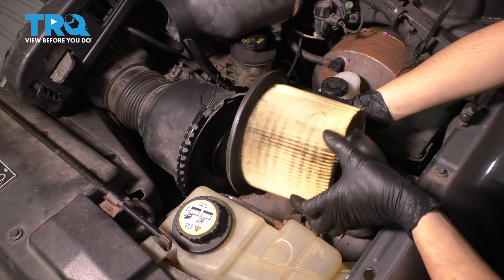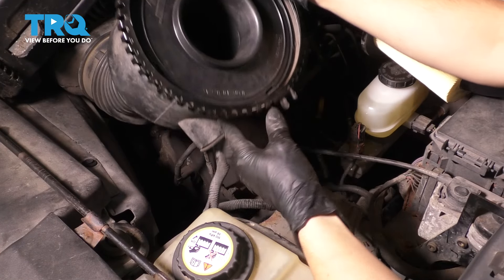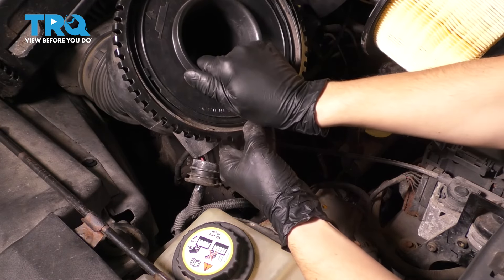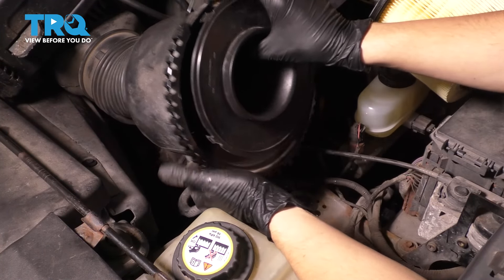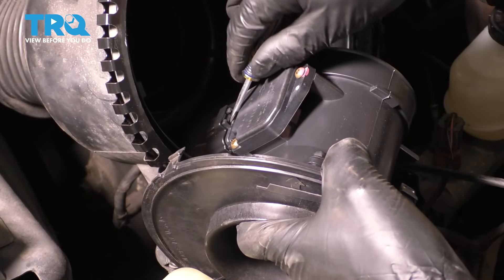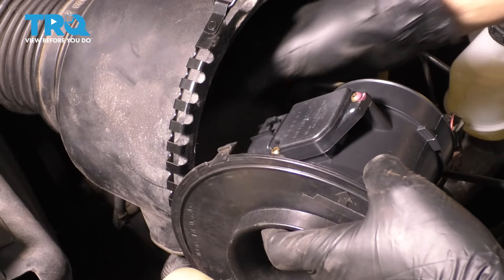As you can see, this one wasn't too bad, but it also doesn't look the best, so we'll go ahead and set that one aside. With that out, you'll notice that underneath there's a wire. Go ahead and gently pull down on this rubber gasket here, then grab this piece — you can see it moves around — and you can simply slide it out back here. You'll see the connector; press on the tab and try to slide that out. Sometimes it's easier if you come in with a pocket screwdriver on the other side to pry up on the connector.